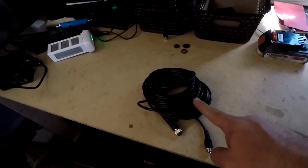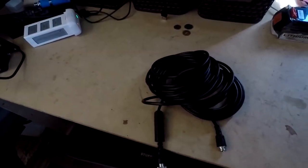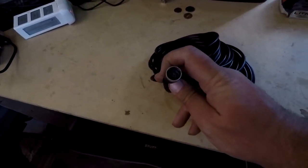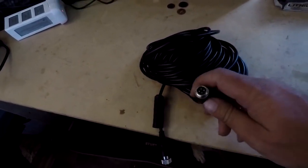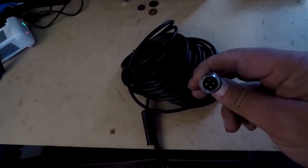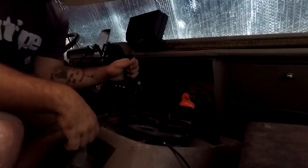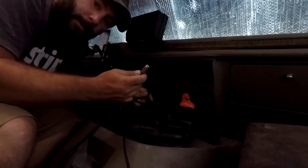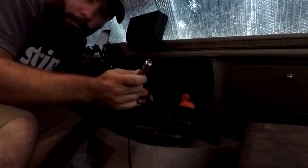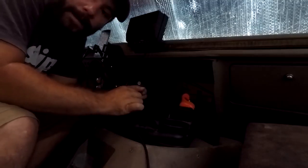Inside the RV I need to install the cable and run it from the front all the way to the back. It's worth noting that the wire ends are not the same — one is female, one is male — so make sure you install them the right way. The male end plugs into the back of the camera. I ran the wire behind a panel, through a hole with a grommet I made earlier, and then under the RV. Once the cable is pulled through, connect it to the corresponding cable — in my case the reverse cord, which is brown — and screw it on nice and snug.